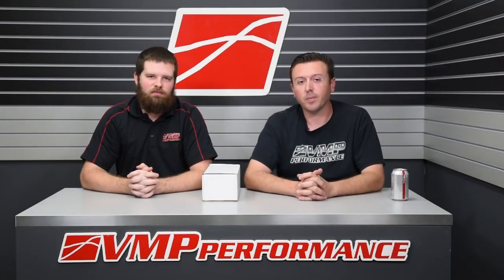Awesome. Slapcheck wants to know what shifter can truly shore up the 13-14 first to second shift. I saw you joke with Andrew on his video about his shifting. That factory shifter is not really accurate. It doesn't seem to be just a shifter issue. It seems like it's partly a shifter issue, partly a 1-2 synchro issue in GT500s. Or is it the synchro going because the shifter's not aligned properly? Well, the 13-14 shifter is the best one they've ever put in a GT500.